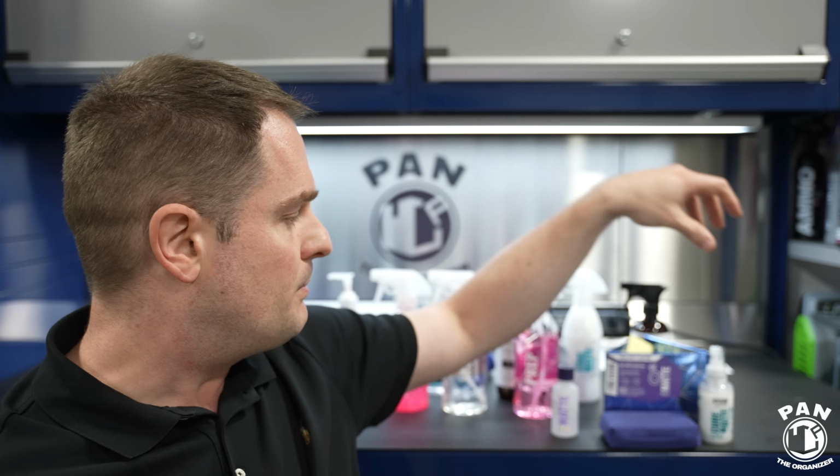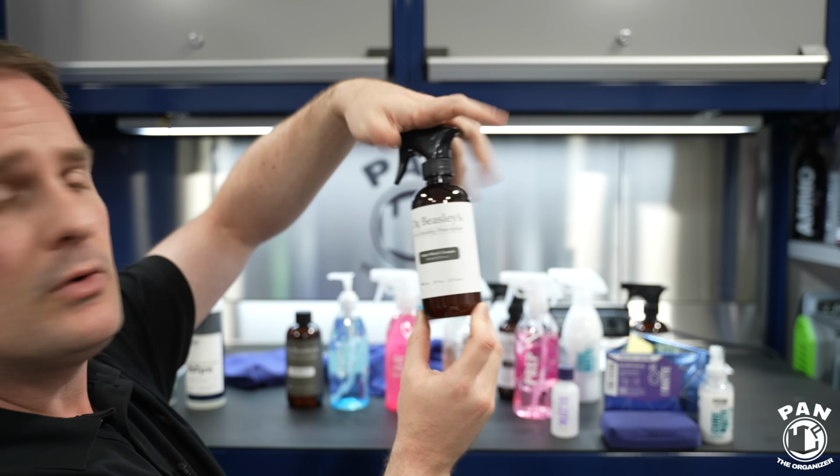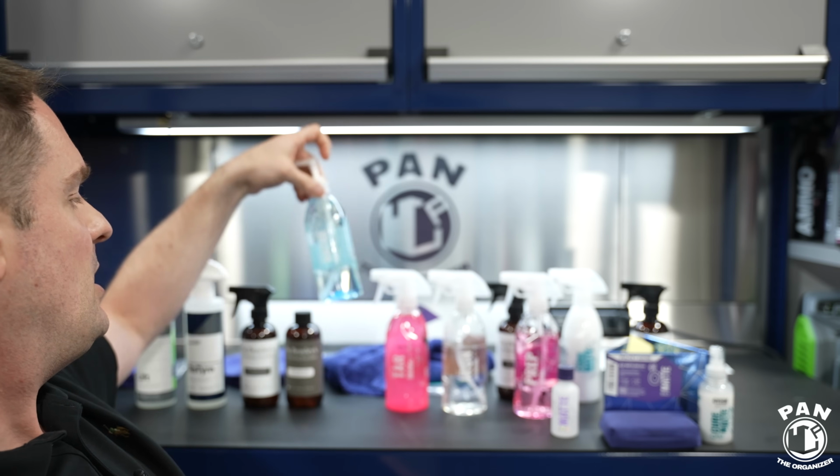You protected the wheels, and of course to clean the wheels, well, you always have the matte wheel cleanser if you want, or for those of you who just use shampoos, you can use the matte body wash or Geon Bathe, whatever you guys use to wash the paintwork. You can also wash the wheels and tires as long as you use a separate bucket. Do not cross-contaminate your wheels and tires stuff with the paintwork, right? Always do that separately. That's why I use the 3 bucket method. So 2 buckets for the paint, 1 to rinse and 1 with the wash solution. And the 3rd bucket is my wheel bucket because I like to keep things separate, but whatever works for you guys as long as you're careful with what you're doing.